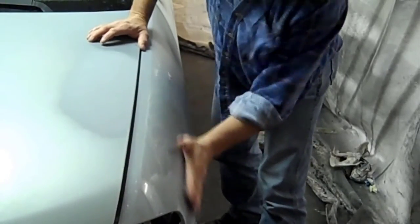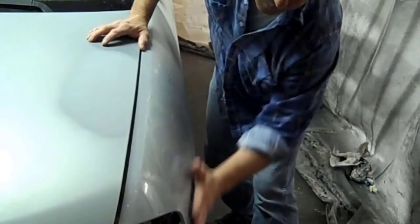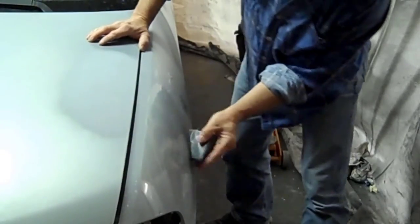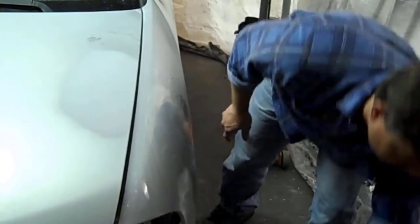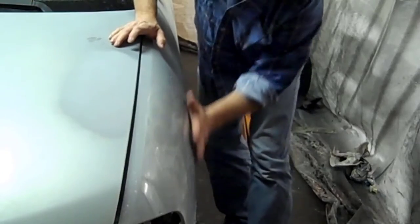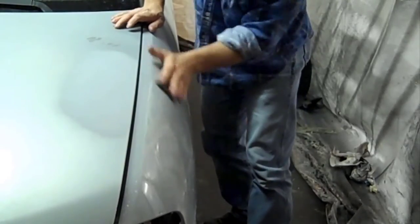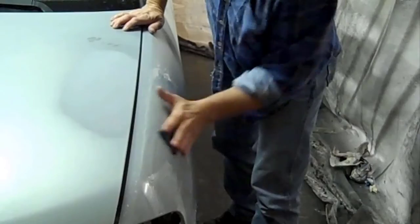My process has always been to work fillers and maybe damaged areas with a rougher sandpaper, but I always try to stay finer. A lot of people will use something as rough as 36 to 40 grit. When you cut those kind of scratches, it's hard to remove them, so my method is always to work my way into a finer paper, and you get a slicker finish, and the paint still sticks. As long as you've got a 400 grit scratch on a surface, paints, sealers, anything like that will stick.